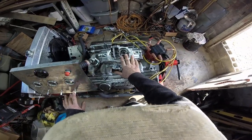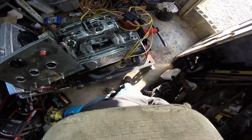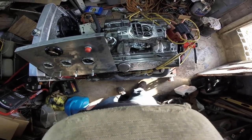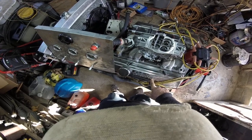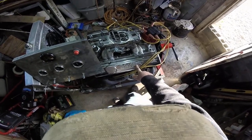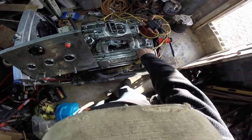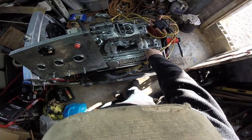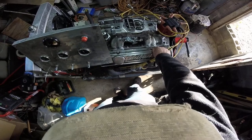It's a 350, standard bore. I bought the short block from somebody, and after having the freeze plug leak, fixed that. It's a standard bore 350 with flat top pistons. The heads are 64cc — NKB aluminum heads, Chinese heads, new kids on the block. 202 intake, 160 exhaust. The heads came from a place in Kingsport, Tennessee called Skip White Performance. So far so good, I can't complain about them.